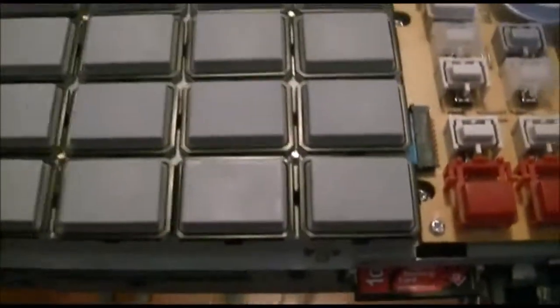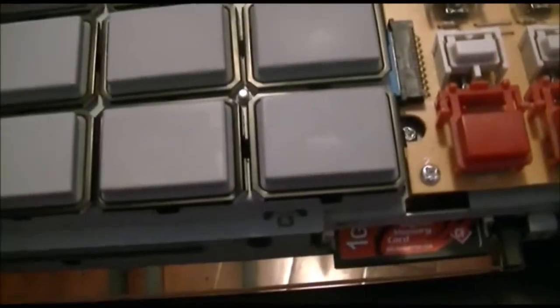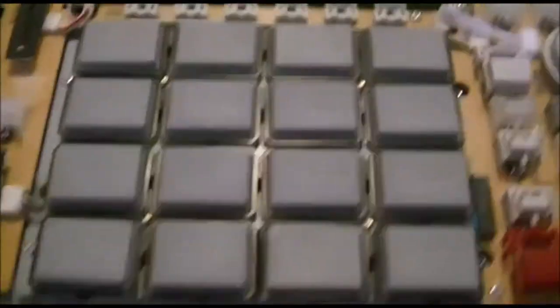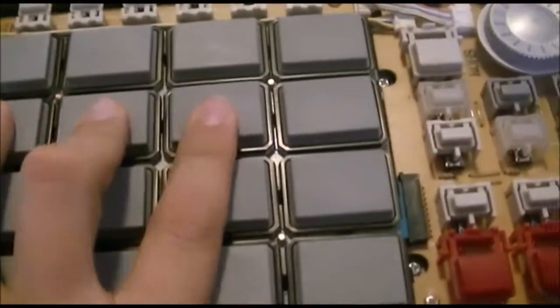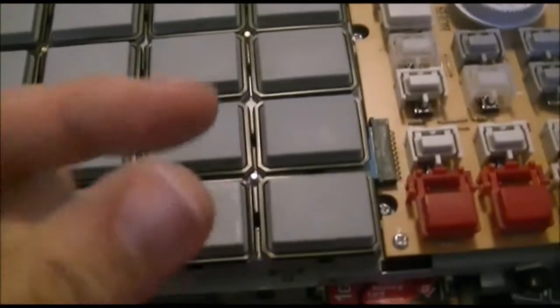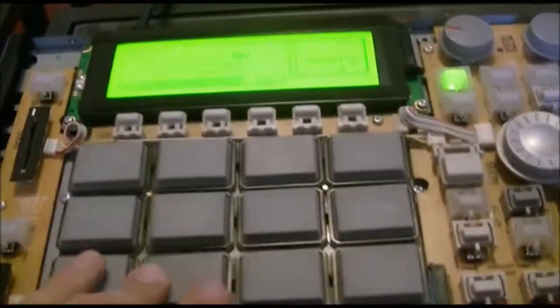I had to keep on replacing them and opening them up and putting different amounts of tape in there. Some I found worked with the 2 pieces of gaffer tape. Some seemed to need 3. The best ones seemed to have the tape cut into a nice little square to fit on the sensor pad. If there was too much tape in there, they didn't seem to work as well, so that's something to take into consideration when you do it yourself.